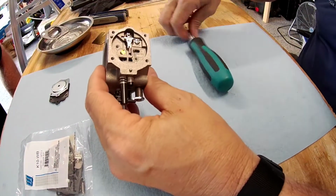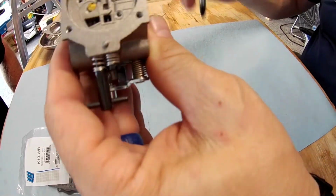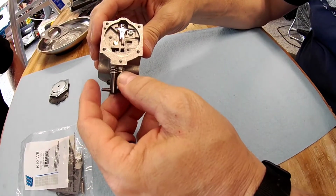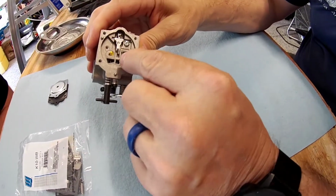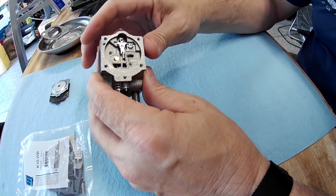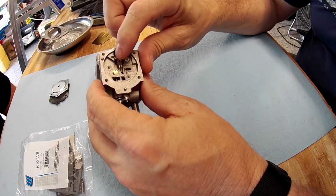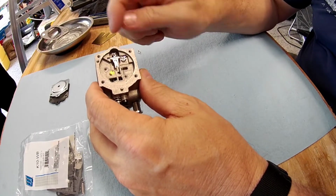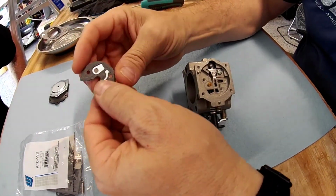But just so you know, there's your high screw, there's your low screw sitting in there. You can see those inside. So what I will normally do is mark where my settings are. On a full rebuild, I'll take these two out so I can completely blow back everything. Sometimes this will wear in here, so you'll need to replace the actual needle itself, but you're going to have to put several hundred hours before you ever have to worry about anything like that. And then this is going to be the pop-off lever and the spring, and the little plunger under there will take off in a second. So, more parts that'll come in your kit.